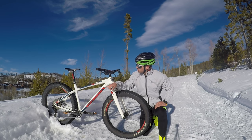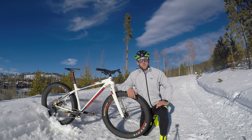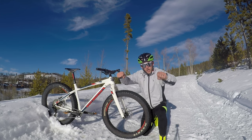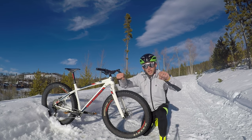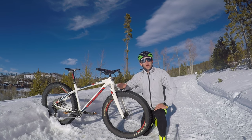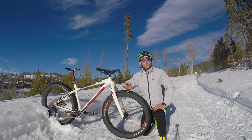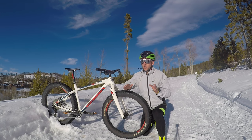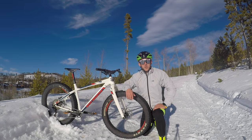Rocky Mountain designed this bike with shorter chainstays at 434 millimeters. It's got a bit of an extended top tube to give you an extended reach and a more aggressive position, which feels really good. It's designed with a narrower Q factor — roughly 44 millimeters narrower than the industry standard — which makes for a really comfortable feel when you're pedaling this rig.